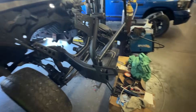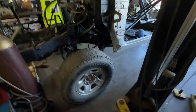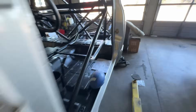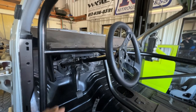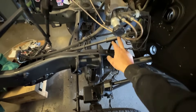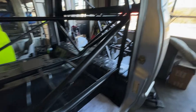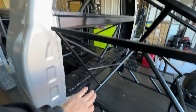This truck has a front clip — I think David took it home so it didn't get broken — plus fiberglass bedsides and fiberglass doors. For brakes it's using all factory stuff with a Wilwood proportioning valve that you adjust. It still has the factory steering box, but we got rid of the factory steering column. We used a Strange steering wheel with a Tim McCamus steering wheel kit, and had to create a mount for it. Brandon did a lot of this work.